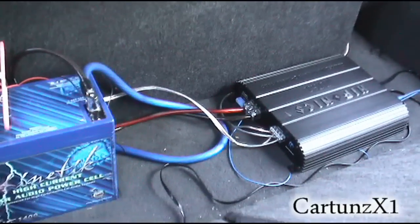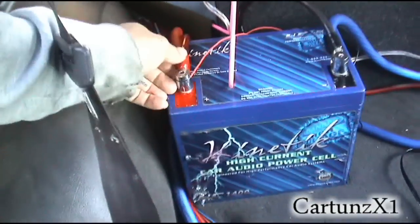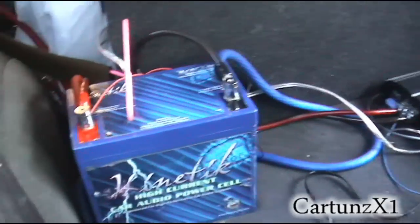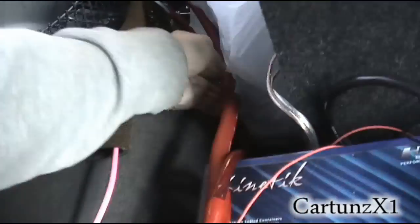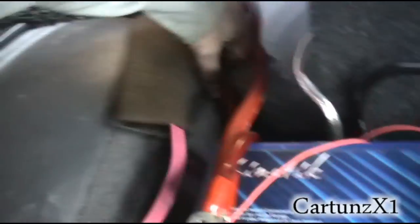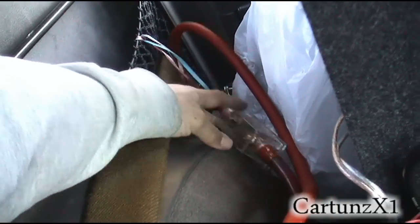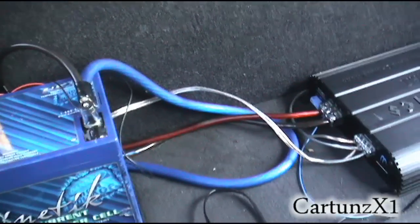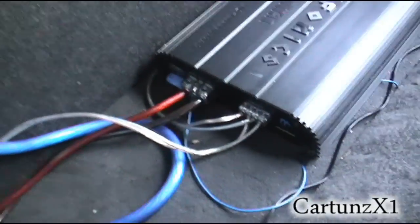It's not a final setup yet, but I can't drive around with nothing. Here I have the power and negative going straight to the amp without a fuse, and then I have an inline fuse on the power wire right here. I got a 250 amp DB link fuse back here — it is fused from the front to the back. I've got a circuit breaker in the front and the fuse back here. The amp still has a single 60 amp fuse in it as well.